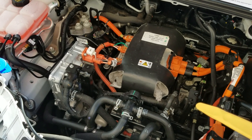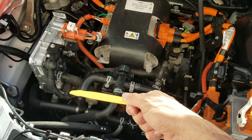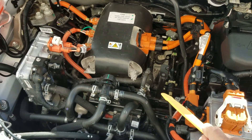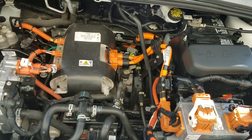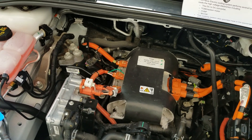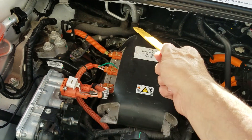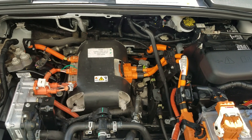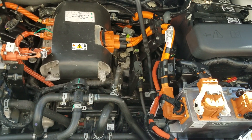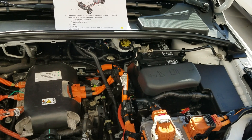There's also a thermal management system. This car has three loops. There's a primary loop, or MECS — the motor electronics control system loop. Coolant flows and cools the DC-to-DC converter, the TCM, and also cools the oil lubricating the traction motor. A second system involves the PTC — the positive temperature coefficient box — where these hoses connect. When that heater runs, it flows to the heater core and heats the cabin. The third loop is controlled by a valve here, and that cools the BCCM, the battery pack, and by default the BECM. This distribution device doesn't get cooled because it doesn't generate significant heat.